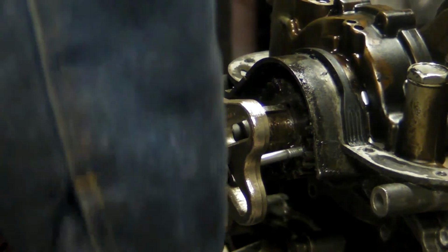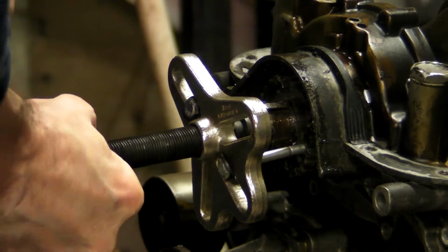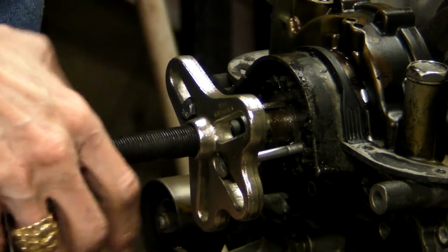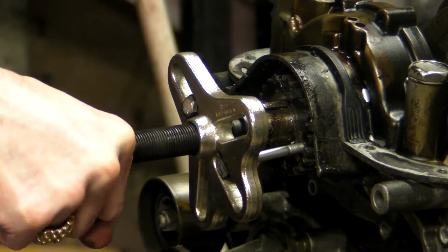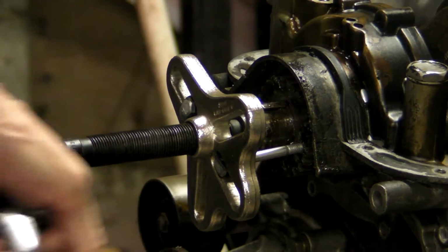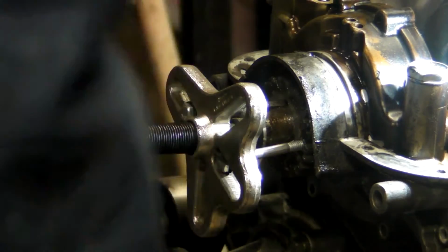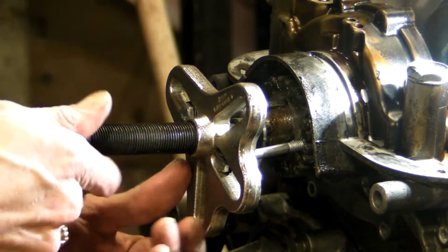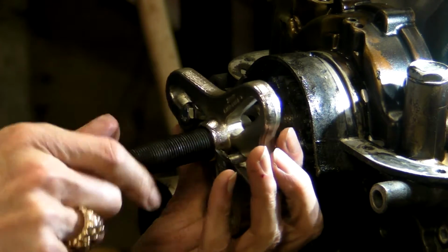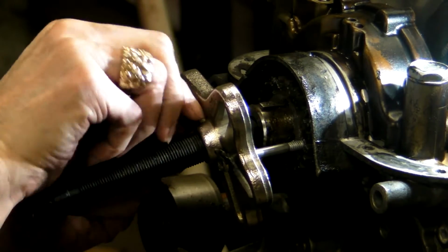In fact, if you look at that bolt towards the bottom, you'll see that it's pulling through the puller. It's destroying my fancy hardened steel washer and pulling it through the puller. So this one's stuck on there. It's time to give up. Get some new spacing devices on there. Those washers have wrapped themselves around the head.